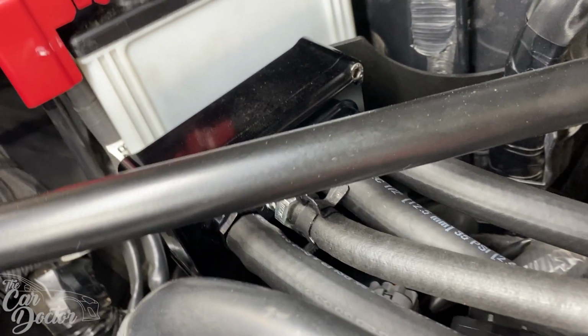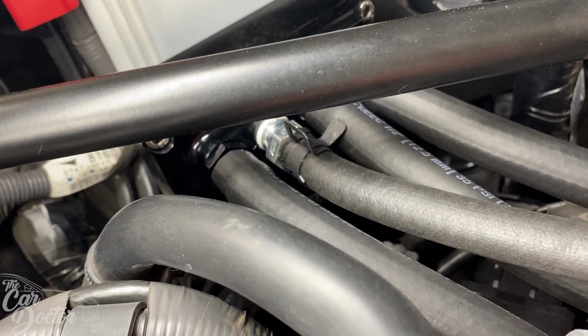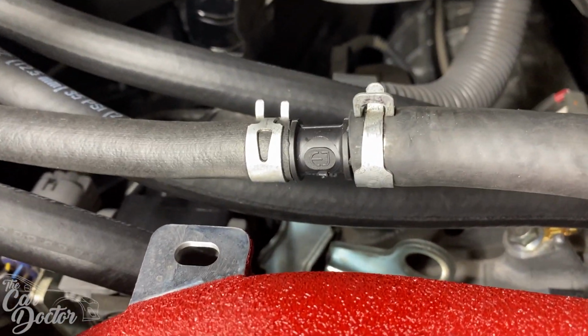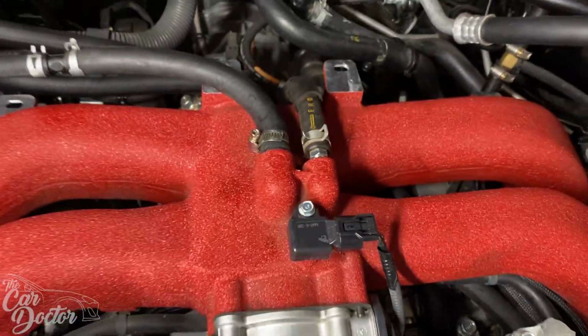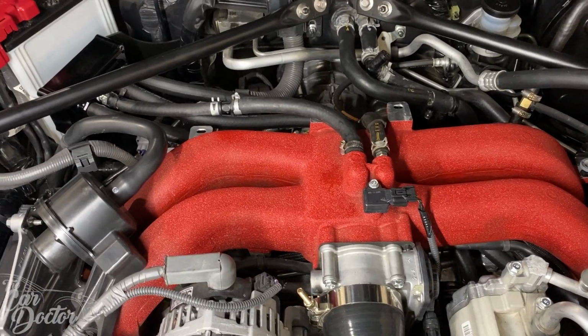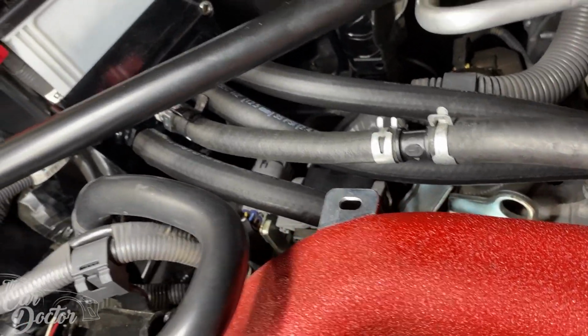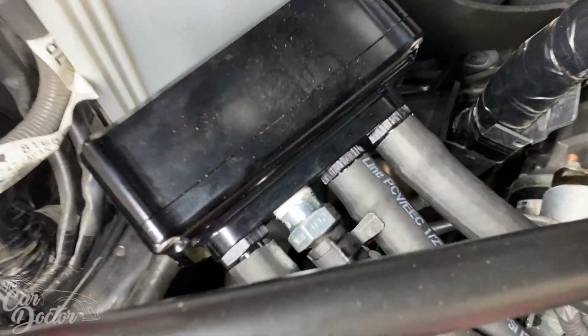Then this second one, the one that doesn't come with a fitting, you put the PCV valve that you removed off the block on that, and that comes with like a little adapter that switches it to a bigger hose, and that hooks up to this part of your intake manifold. So whether you're boosted or NA, that's usually the way to go. The PCV valve is gonna help stop the boost from going back into the catch can, but the vacuum is gonna work. So the 2 center ones are vacuums.